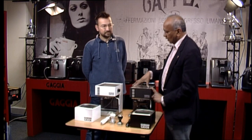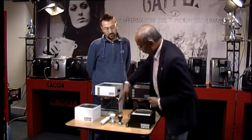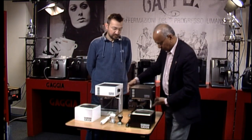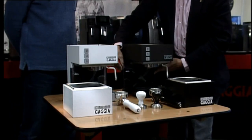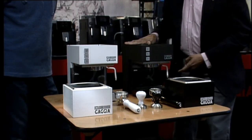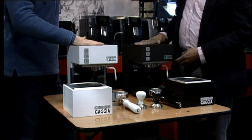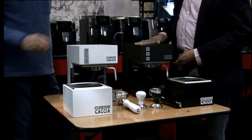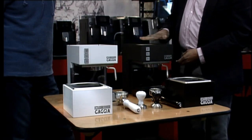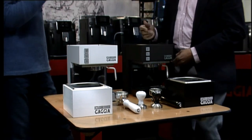These particular ones are about 15 years old. You have got a water tank which actually comes out to the side — it slides out so you can pour water in. There is a water tank where you can just push in, push out, put water in. It has got a really nice cup warmer — it's quite nice for a small machine, even bigger than the Classic's cup warmer. It's because you've not got the space taken up from filling the water tank. It warms up quite nicely — it's not electrically heated, it's just the latent heat from the boiler itself.